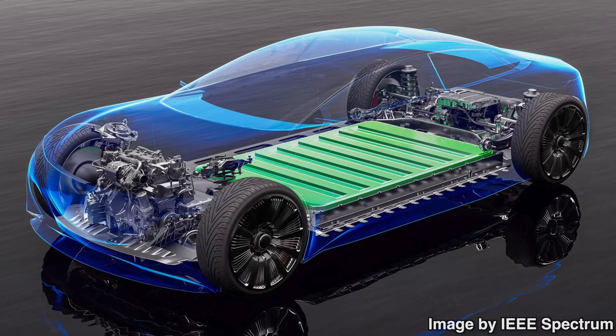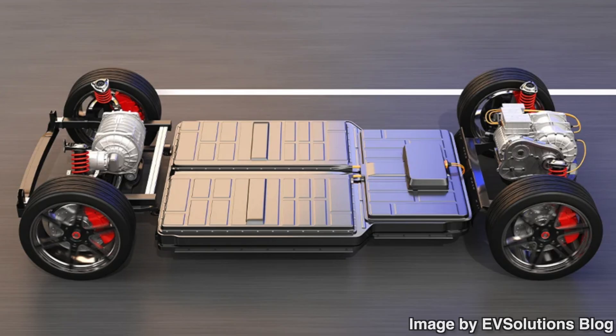What about the huge battery in the car — why can't we use that to power the dash cam while we're parked? That battery is actually mainly for driving the vehicle. A lot of people get confused — I was even really confused with my first EV because I thought it should just use that battery. But that battery is something ridiculous like 480 volts or 600 volts — not 12 volts like these dash cams are designed for. I'm not a professional on that; I just know how to install dash cameras in them. Realistically, they're not meant to support that.